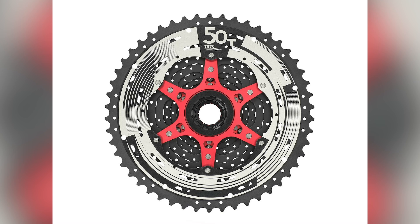If you get that cassette, you can use all that SRAM niceness with it and it'll make your bike a 12-speed little monster. So all hope is not lost, although maybe a bit of a spanner in the works. Stand by on that because you may get some chance to fit an XD driver, but personally I'd just go for the Sunrace and get on with it because you've already got that good stuff sitting around.